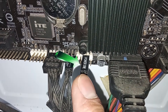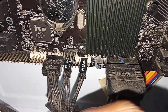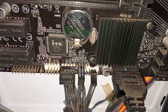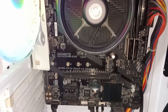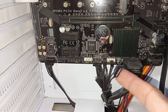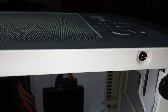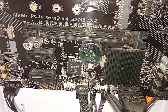Find the power switch pins on the motherboard. Touch these pins together using a conducting tool — when the PC is connected to power, the motherboard receives a signal to power on and it can boot up. If your PC turns on, it means the issue is with the wire from the motherboard to the power button, or the power button itself is broken. You can shut down the PC by touching these pins together again.